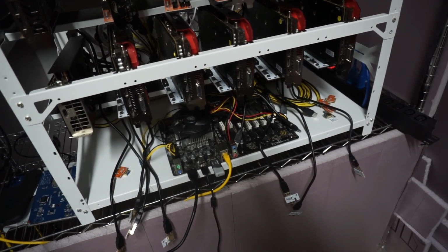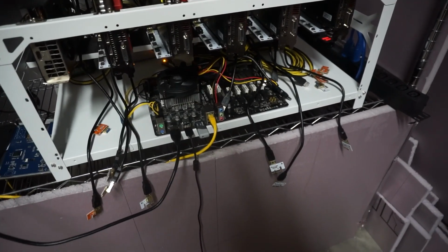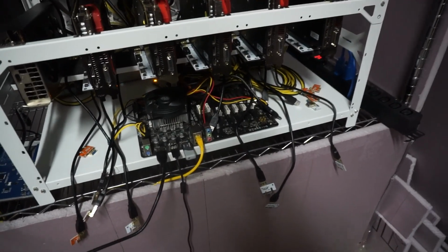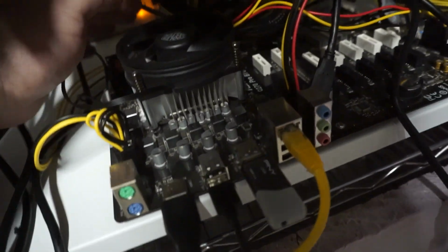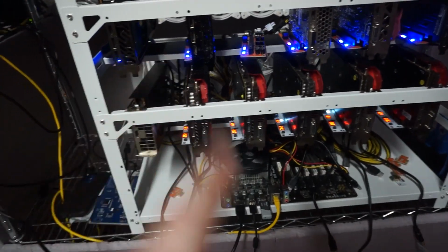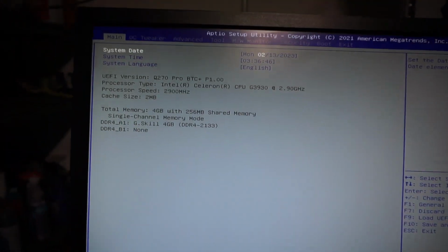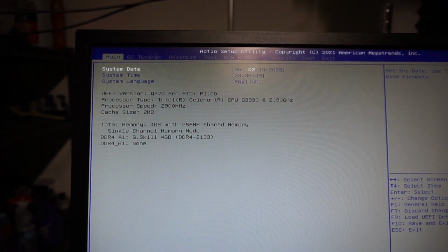So I have my monitor right here. I got my keyboard. Let's get this thing to go into the BIOS, and let's try to do this BIOS update so we can get headless operation. See if I can reach my hand in here. Turn the power on. Probably not going to like me. I might even have to reset the CMOS if this thing is picking a GPU, even though the last time I remember doing this, I set it to integrated graphics. Okay, so all I had to do was hit the reset button, and it did get into the BIOS.